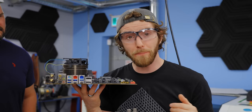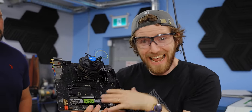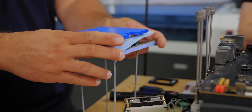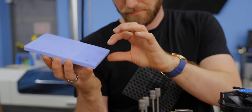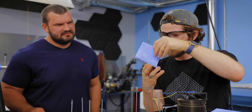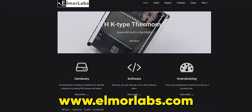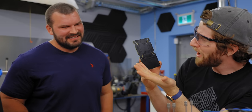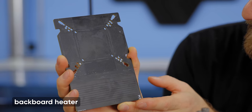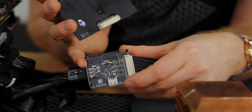Printed circuit boards are made of copper, which is an excellent conductor of heat and cold. So if we put something really cold here, it's conceivable the entire thing would get really cold really fast without other heat sources. That's a heater. This is a giant centimeter-thick thermal pad, and under it is an E-hot heater made by Elmore — another famous overclocker. It's basically the same thing you'd find on your rear car window for defrosting: high resistance wires on a PCB. You just use a simple six-pin PCIe connector and it just heats the boy up.